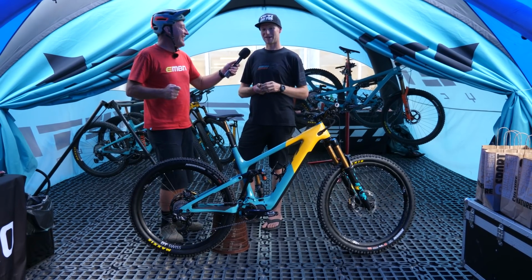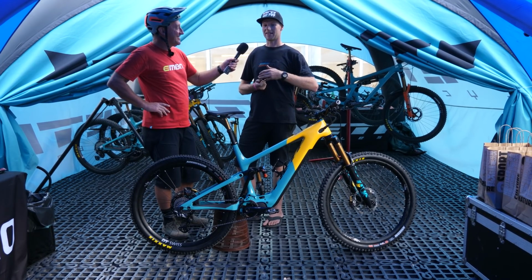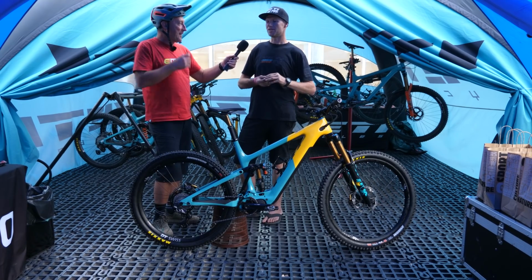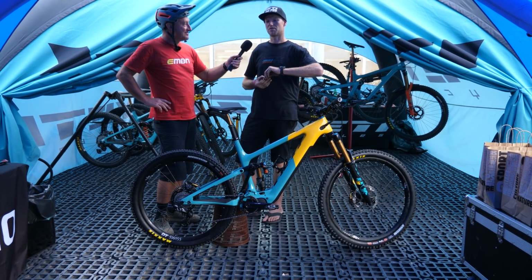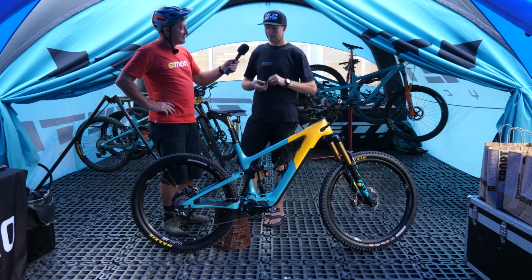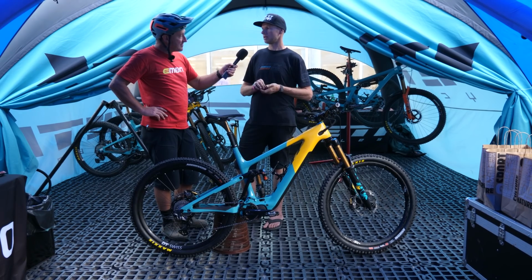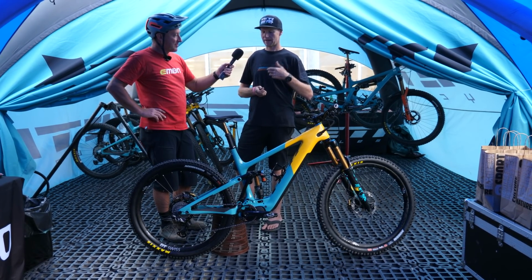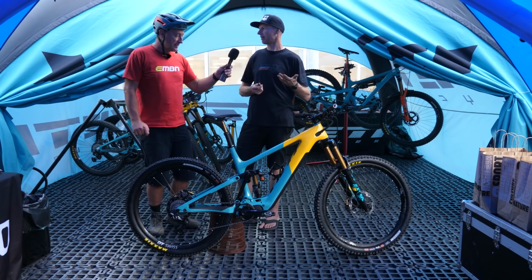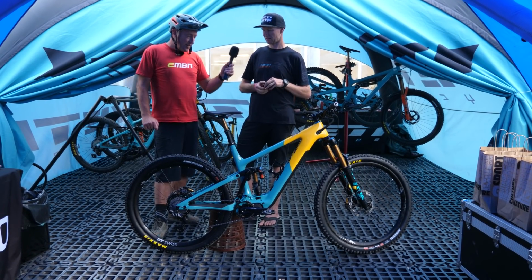Yeah, you buy the bike and it's set to your region. So, for instance, my bike was programmed in USA. It's actually still in USA programming. So I do have access to the Shimano E-TUBE software to play around with that. We can even measure the rollout of the wheels, and I can put in an exact millimetre rollout. So if they change tyres, to get the maximum efficiency out of the motor, I can change the rollout of the wheels. That is a bit more of a background thing, and you don't really have to worry about that at a consumer level, I don't think. You pick a wheel size and go with it.